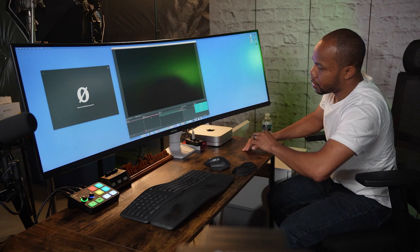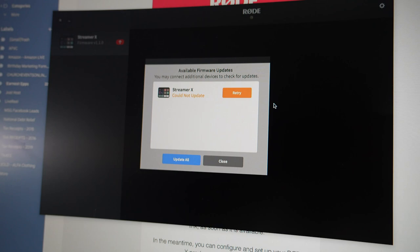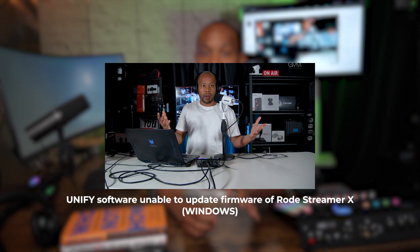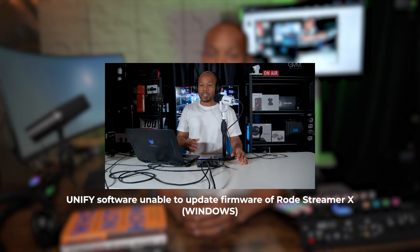When I finally did get it to connect, the first thing I noticed was that a firmware update needed to be installed, which is not atypical — when I'm getting new equipment, I'm used to updating the software and firmware. However, the firmware was unsuccessful in installing, and I'm not sure why. So I took it over to the Windows laptop and tried the exact same process there, and still was not able to update the firmware through the app. But actually connecting it to the computers works just fine — I was able to bring up OBS, bring in the video feed and the audio feed on the Mac, and it works. Did the exact same thing on my Windows laptop, brought it into OBS, and image and audio work just fine there as well. But trying to connect it to the Rode app just isn't working.